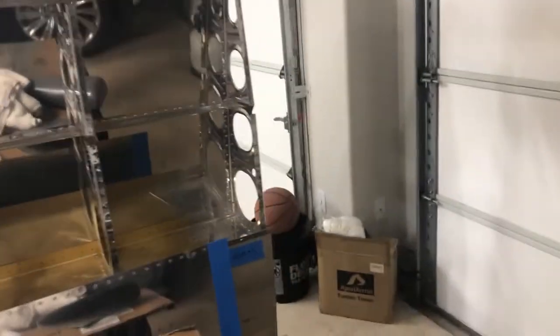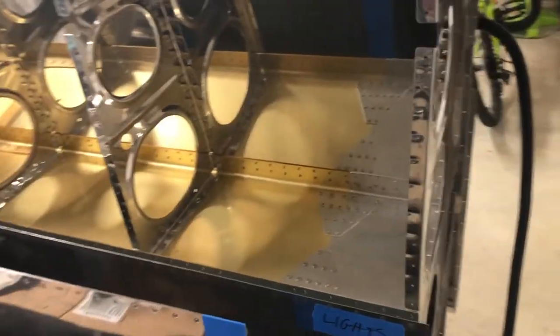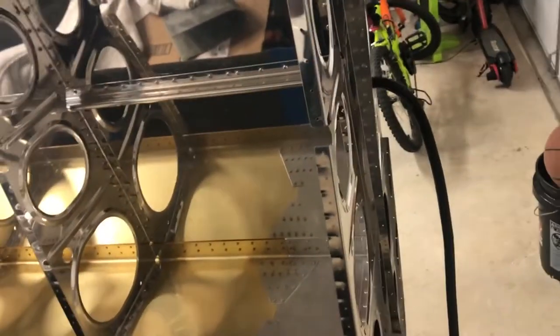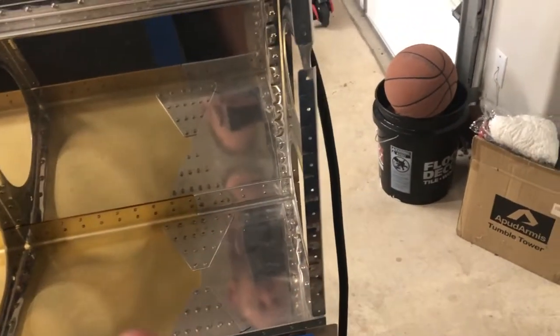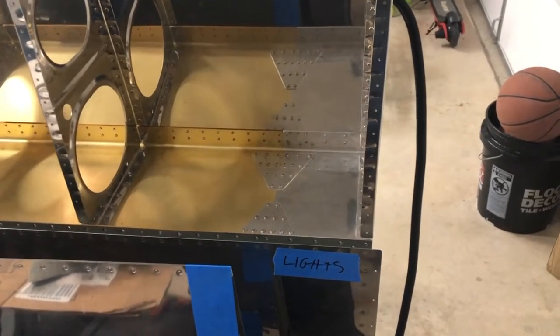One more thing going in the right wing that I'm going to run power for — a GoPro camera mount. There's a really cool system from Flight Flix — I think it's F-L-I-X — that allows you to basically just run a red and a black wire. It's only about one or two amps, so I'm running 20-gauge wire to a little box — only about three by two by two inches — that I could put right here or in the wing tip somewhere. That can be turned on and off from the cockpit to activate a GoPro-type camera.